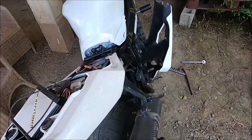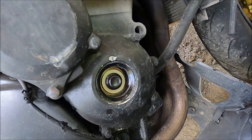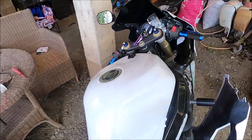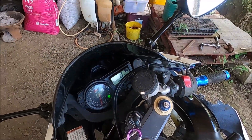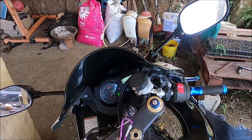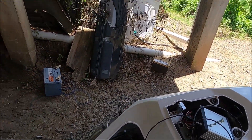My timing light doesn't work so I cannot exactly sync the timing. This is where it's supposed to be — you point your timing light at this to get it to line up. I also don't have a wideband installed on this one yet, as you can see. It's idling right at a little higher than stock — typically a big bike idles around 1000 to 1100, this is closer to 1300 — but the fan works and everything works. I am super happy.